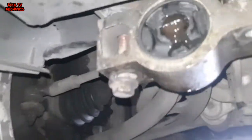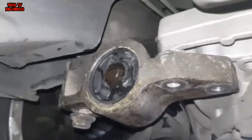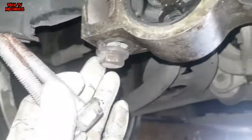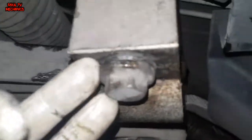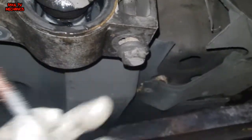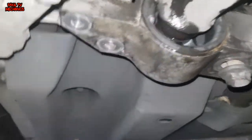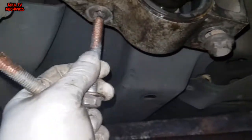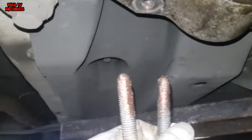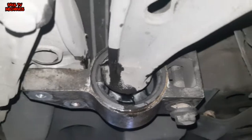Alright guys, there we have it. We've got the bush back on with the aluminium casing — obviously you have to put it on with the aluminium casing. I've got the bolt back on. Make sure you put this one on first — the big 18 milli on first when you're refitting it. Tighten it up a little bit, not fully tight, and then go banging these on. You'll need two hands to line it up. Put the bolts on, bit of copper grease on the end of it. Reverse order, let's finish it off — job done.